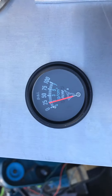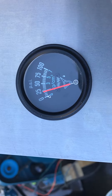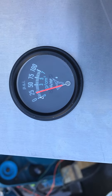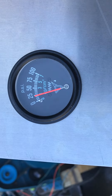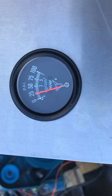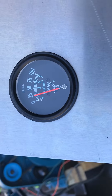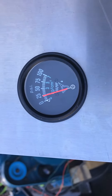Now this might concern you — our oil pressure, according to the manual, needs to be between 5 and 10 at idle. I can back it down to where it's between 5 and 10 at idle. And it's supposed to be 25 at 1600. It does not recommend the 40 PSI that you and I are used to seeing on our cars for the last 40 years.